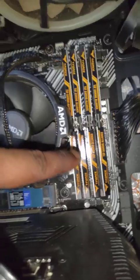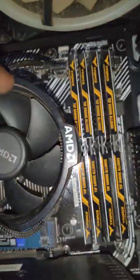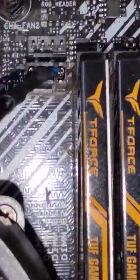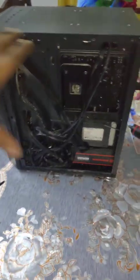After that's done, flip the cooler to the side so it doesn't block the RAM stick. Then connect the cable to the CPU fan socket — CPU fan header right there. And there we go, now I can screw the back plate back on and it should be good.